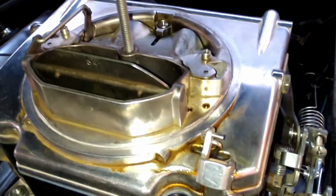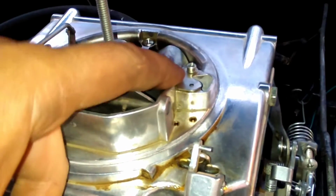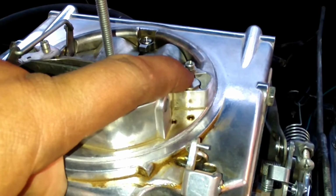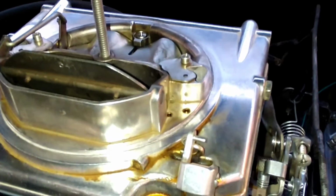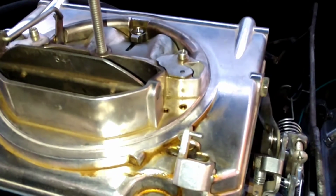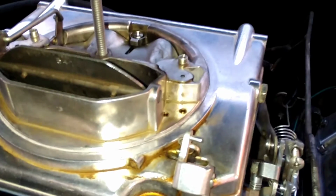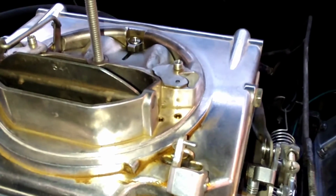You've got a cam and you don't have vacuum, your vacuum won't suck down the pistons that are on the metering rod. And they stay open, and you load up with fuel and you flood out. So they have shorter and lighter springs you can put in there for whatever vacuum you have, so it'll be able to pull them down and close off your main jet.